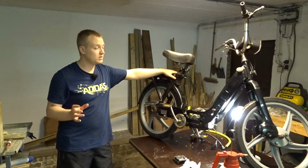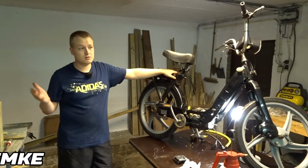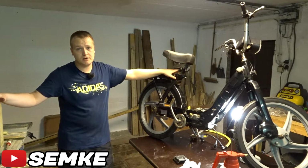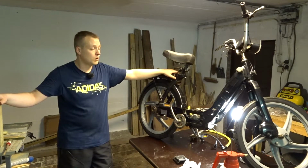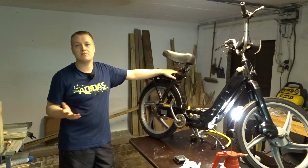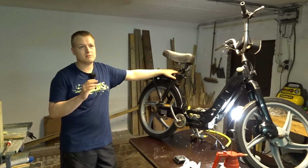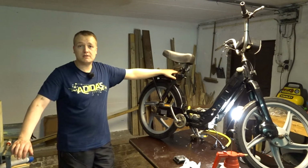Is it the piston rings? Is it something else? Did I get a wrong piston 16 years ago? I don't know. It is not good, guys. I'm going to call it quits here. I'm going to pull out the engine in the next video, go over it, see what is wrong, check the rings, check the clearance, check everything. If the piston moves that much, that can't be right. I mean, it should be loose, but that loose that I can wiggle it around? No, that's not right. So that's going to be it for this video, guys.